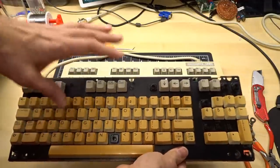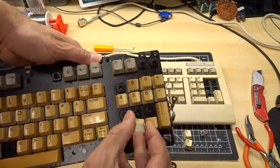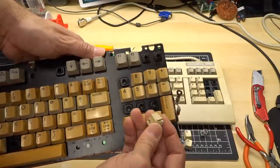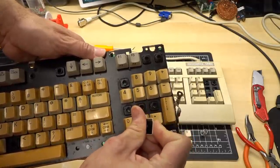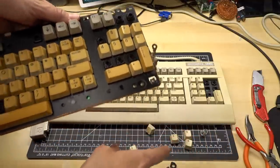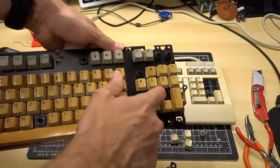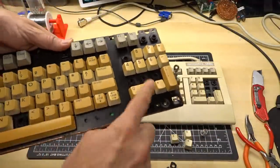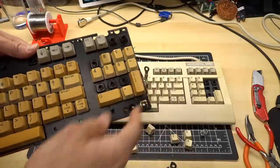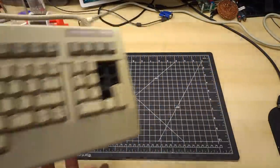Here's my spare C128 keyboard. For the most part I have most of the keys, although I'm missing the 3 key — one of the blown-out ones. But the stem on this one isn't broken, just the plunger, so if I push this plastic back together and glue it, I can probably get a working 3. Combined with the 9 and the plus which are already good, all that's missing is the 6 key — and I have a functional 6 on this keyboard, I'll just have to retrobrite it. This whole keyboard needs a bit of retrobrite. I have lots of plungers, and I can either transfer the individual parts or swap the entire base plate.